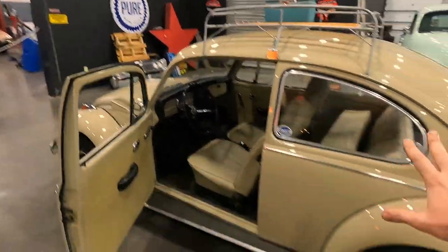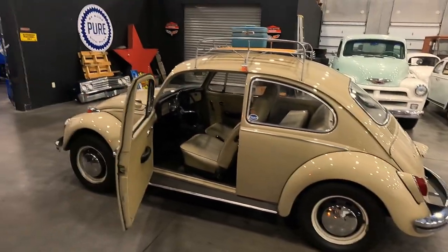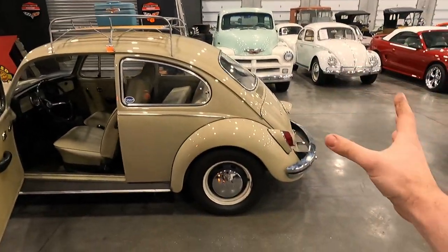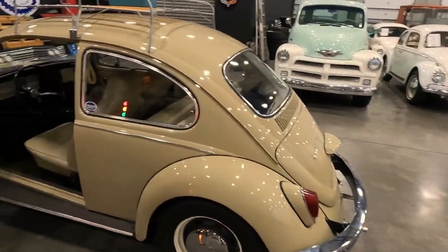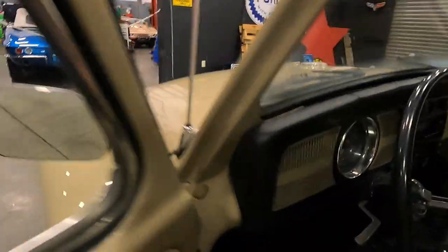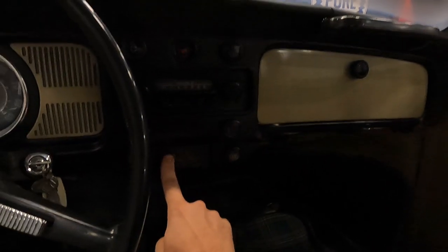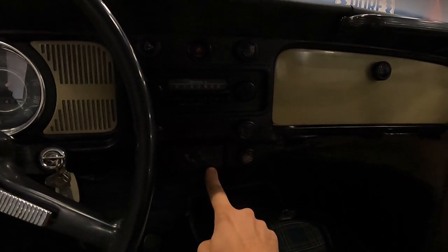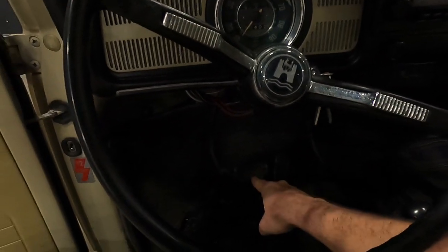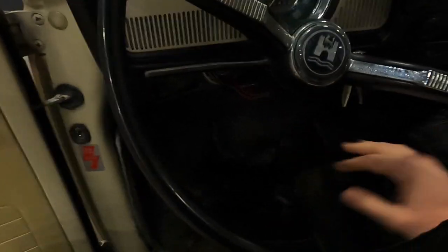There is already a really cool video done by the Jalopnik guys — I'm going to put the link in the description below. They've already covered the ins and outs of this transmission and why it's so awesome. I'm just going to quickly run you through what I see here. I love this: reverse, low, gear one and two. Basically how this works is you got your standard shifter here, gas, brake, no clutch. There is an electronic solenoid underneath the shifter that knows when you are touching it, and that actually engages the clutch for you.